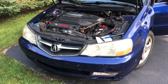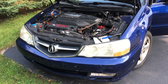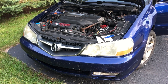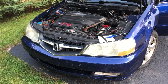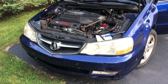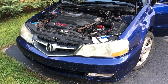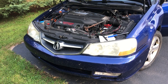Hello everybody. In today's video I'll be answering a viewer question on how to both diagnose and replace a PCV valve, and I'll be demonstrating this on my 2002 Acura TL Type S. The most common sign of a bad PCV valve includes excessive oil consumption or burning oil, and with that some other signs may include excessive smoke coming from the exhaust, difficulty starting the engine, a rough idle, power loss or poor acceleration, and sometimes even a check engine light.